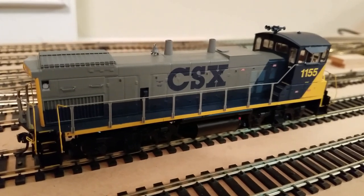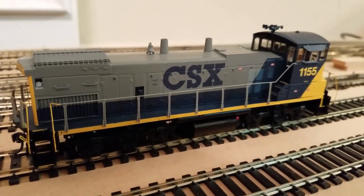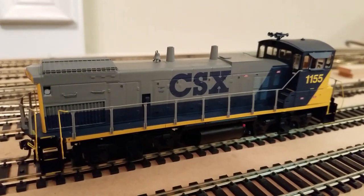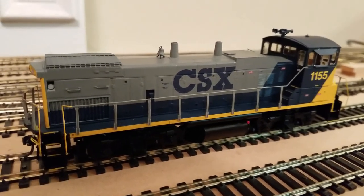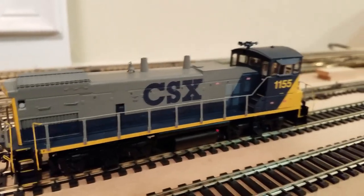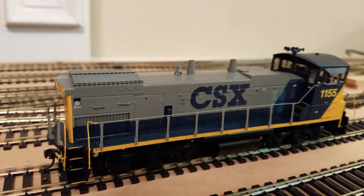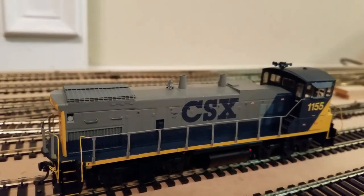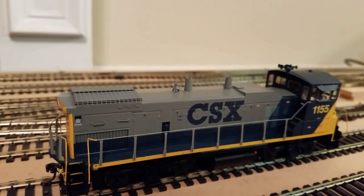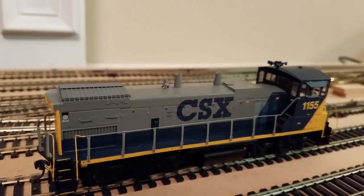So I've got some function wires left that I'm gonna do the step lights, truck lights, and then I'll go ahead and finish it off by finding a resistor that's the right value for that cab light. But so this is just a test right now. I got it turned down by half, so let me put it back the way it comes from the factory, because I've got it set down to 64.